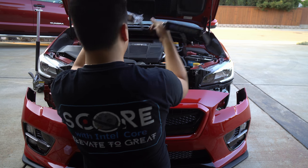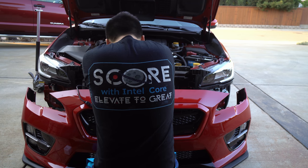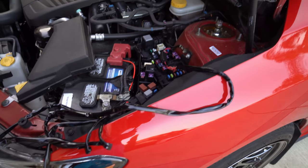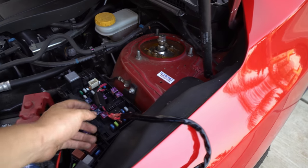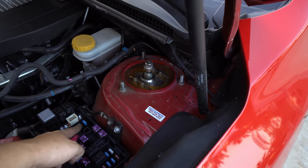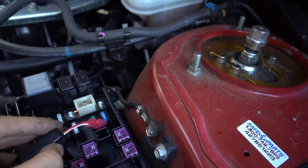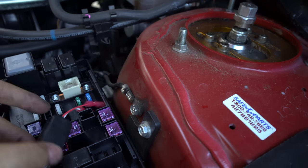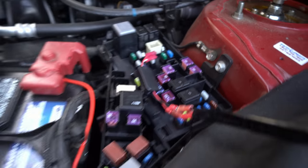You want to have the angle up so it has clearance. A lot of wires, a lot of wires, but it's pretty easy. Red and black goes with red and black — easy enough. This one right here is the little Diode Dynamics box. It goes into your low beams, which is this green wire. And you have the 15 right here which is your high beams, and that will make it so when your headlights are on high beams it will turn it on. So I'll wire up real quick and I'll show you guys how it looks.